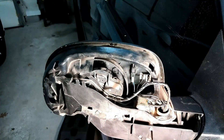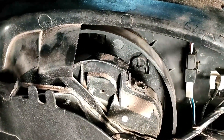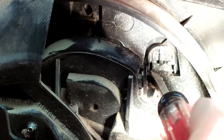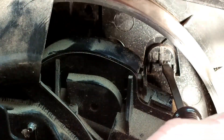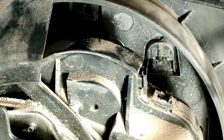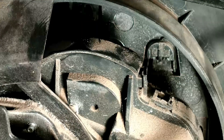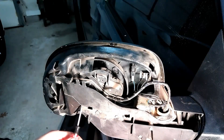There are four clasps and I really only have access to two of them. Let's zoom in and see the first one here. What I'm going to do is wedge my screwdriver underneath it and pull straight up — there we go, and it popped off. You're going to have to do that a lot harder; I pre-loosened it for the sake of the camera. You're going to have to really get in there, twist, and pry and pull up. Once you get that end up, then we've got to go grab the other one. The other one we can only get out from down here, so let me reposition the camera.